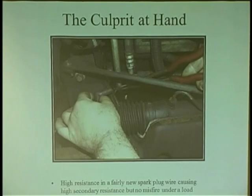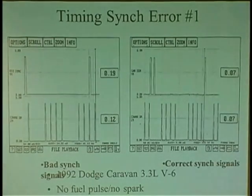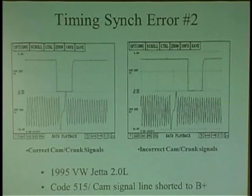So as you understand, RPM inputs all depend on how the shaft is turning, how the sensor is doing its job, what the sensor is actually reading, and also whether it's exposed to any type of EMI, electromagnetic interference. One thing too about RPM sensors, we need synchronization of sensors, because computers need to see them lined up. We talk about trigger wheels moving. So let's talk about this here.